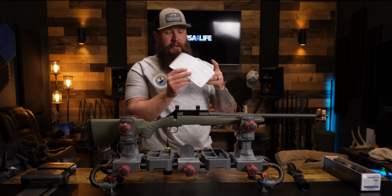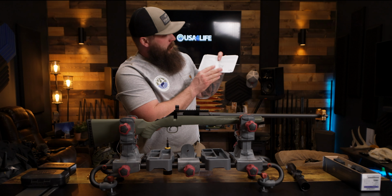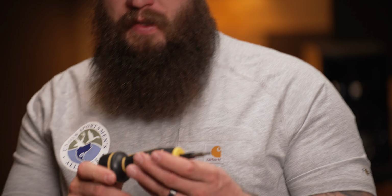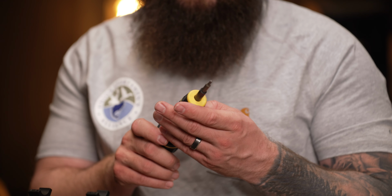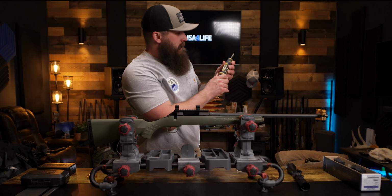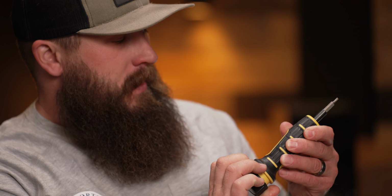Doesn't work out well. All right, guys, so on these rings, if you look carefully, every single set comes with the torque instructions inside, okay? So this tells you where we want to take this. If you read here, it tells you to tighten the screws to 25 inch-pounds, okay? So that's crucial so that you don't over-tighten or under-tighten and break these rings. So on this tool right here, all we're doing is cranking this down, setting it to 25.